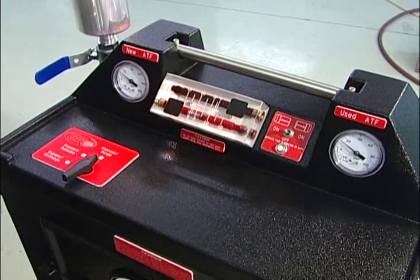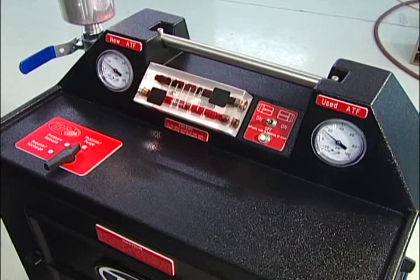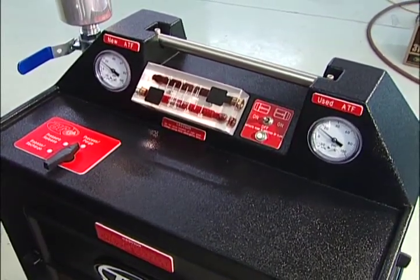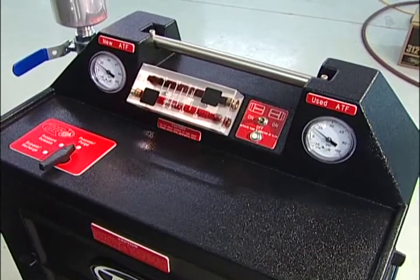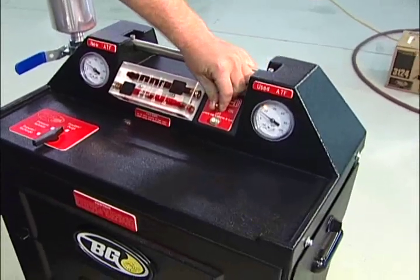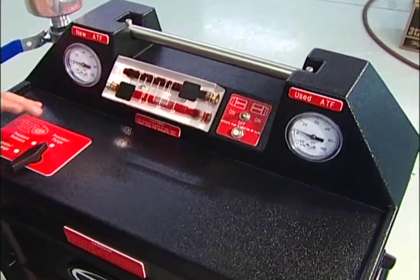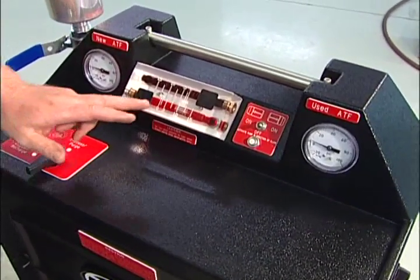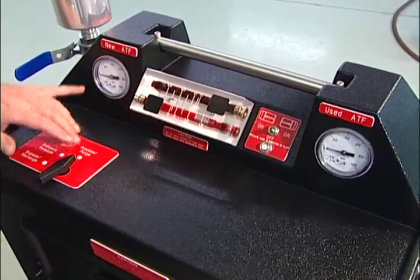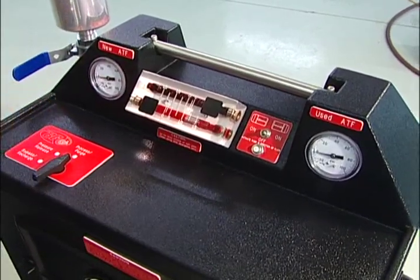The reason we'll see either an increase or decrease in pressure is because of where the pump is located — between the vehicle and the machine. If we're pumping from the vehicle to the machine, pressures are going to go up. If we're pumping from the machine back to the vehicle, pressures are going to go down. So we're going to go ahead and turn the pump on. It's a new machine, so some air bubbles are normal. As you can see, our pressures went down, which means we're pumping from the machine back to the vehicle.